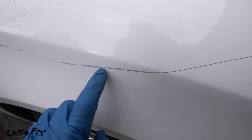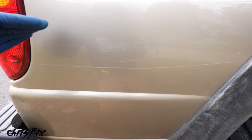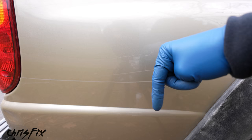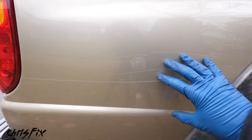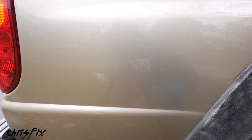This is definitely a deep scratch — it goes through the base coat into the primer, it's not just a clear coat scratch. If you have a clear coat scratch like the one on my truck, that's super easy to repair and I have a full in-depth video linked in the description. To verify a scratch is only in the clear coat, get some alcohol on a rag and wipe it down — it should temporarily disappear. After a couple seconds the alcohol evaporates and the scratch becomes visible again. That's a good way to tell if you have a clear coat scratch.